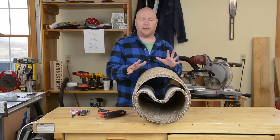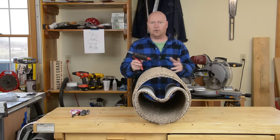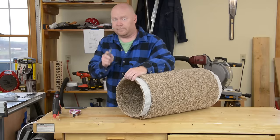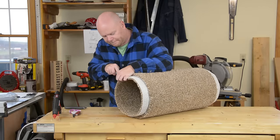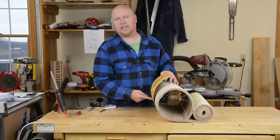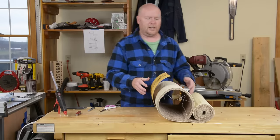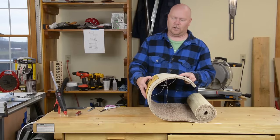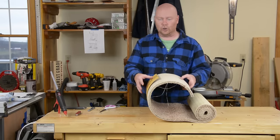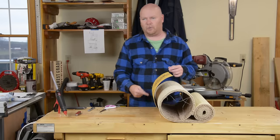So you're going to have to get it in there and stretch it out as best you can. Make sure you've got it pretty much exactly the right size and you're just going to have to bite the bullet and cut on a line on the backing. With both edges safely glued down I can smash the tube in the middle and start gluing this in, and of course yet again trim with the razor knife. The u-shaped ones are the easiest of the lot — you're going to leave the seam on the bottom somewhere. Just take your carpet and start gluing to the inside, then fold it over and worry about cutting it when you get there.